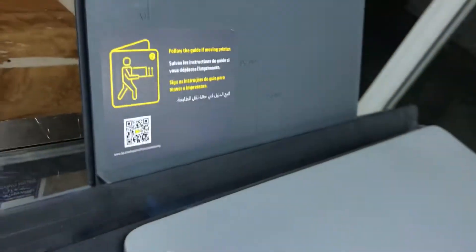I will remove the paper. There is a problem — it's not feeding from here. Let me show you with a light. I put the light here — this is the feeding roller place where we insert the paper. First of all we will check if there is anything visible here. There is nothing we can find here, so it means the problem may be with the feeder roller or something went inside.